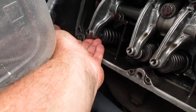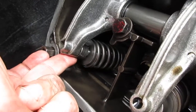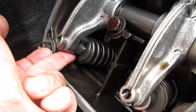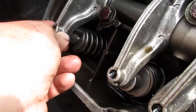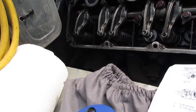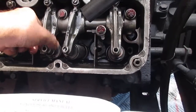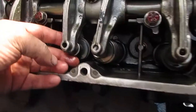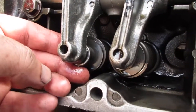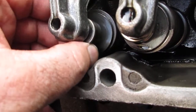This is a common 9-liter problem right here. That's an exhaust valve on the back and you can see how much movement that wear plate has in it. That's because this rocker arm is out of adjustment a lot — probably 10 or 11 thousandths — which is not catastrophic but definitely needs to be taken care of. And there's another one up here. You can see the slop in that. It's supposed to be a little loose, but certainly not like that.